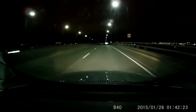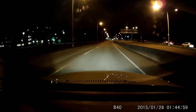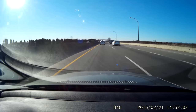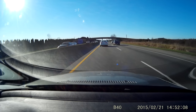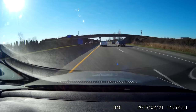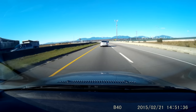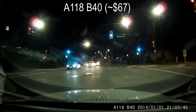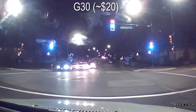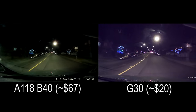It's going to protect you when you get into an accident and it's going to be worth every penny. The reason the video quality is so good is because it has WDR — wide dynamic range — which allows you to see into the shadows and the bright spots at the same time by processing the video to record a lot of detail. Daytime looks pretty good; on a nice sunny day when you're driving into the sun you can still see into darker spots and it doesn't blind the camera. When driving away from the sun it looks best — you've got the best video quality and can see license plates.